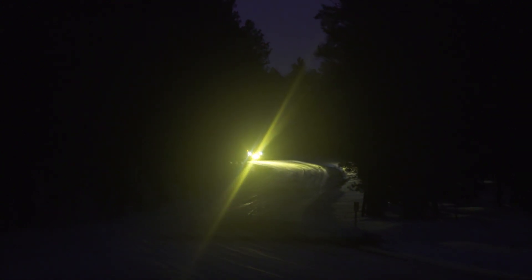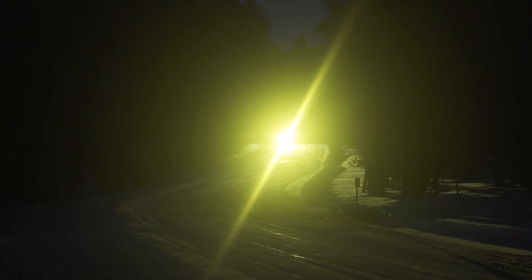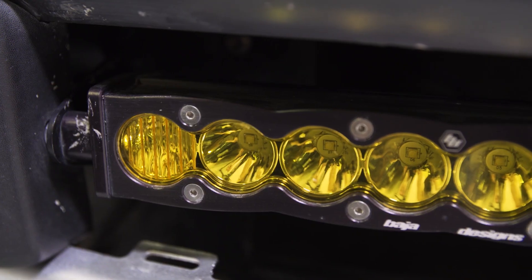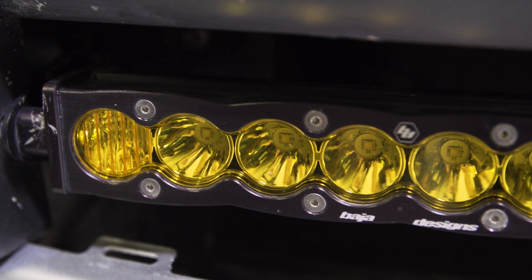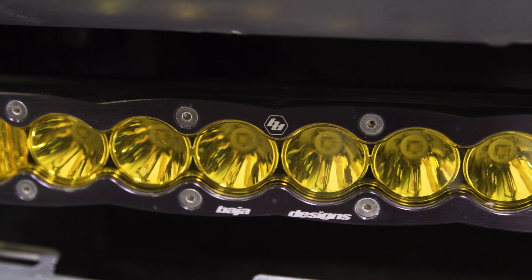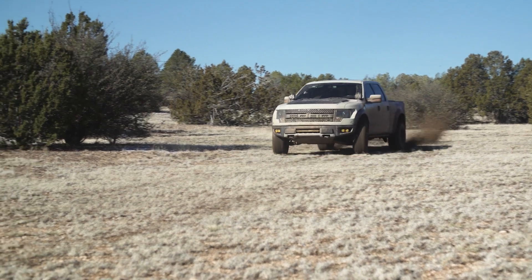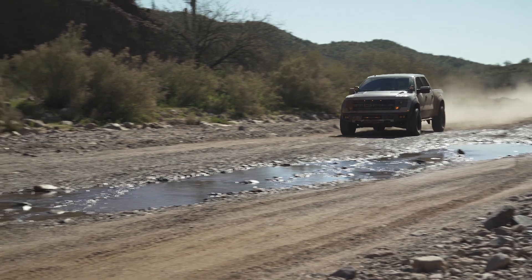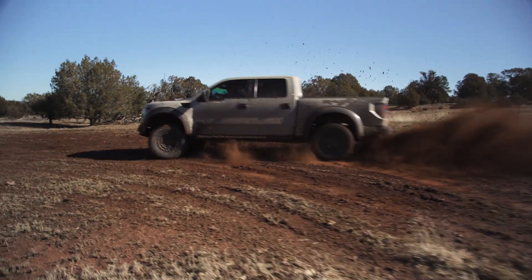In terms of actual light output from these S8s, the 20-inch bars are capable of cranking out 8,000 raw lumens and they use 16 LEDs to make that happen, which is a pretty solid amount and definitely offers a good fill for most vehicles and most off-road applications. Durability is also pretty exceptional on these Baja lights, as it has been with their other models. These use an anodized black aluminum housing that also has a hard-coated polycarbonate lens, allowing it to take the abuse of rocks, sand, and branches when driving off-road, while also withstanding water crossings, wet and rainy conditions, and even romping through the mud.